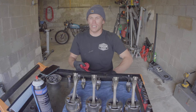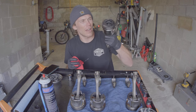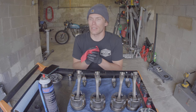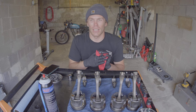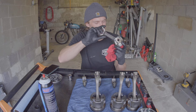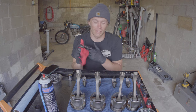How far is it worth to go? For me personally it's tough to say, because on the one hand I see this engine, even if it was subpar, as an upgrade. On the other hand, I feel like I've had better-looking pistons come out of my other engines — they're not scratched or scuffed real bad, but they're just really crusty. So I'm a little bit torn, and it is already apart, so it does beg the question: should I just do it now and have a really bomber TDI motor? There's definitely some creep there, and then as I'm reading threads, I'm seeing oil pump upgrades and other things jump out. How far do we really want to go? It's not cheap — a new set of pistons, if you get the same non-oil-gallied ones as these — there's no additional oil cooling under there — they're like $360 or something, and then you can get the oil-gallied ones for like $600-ish. It's expensive.